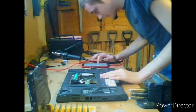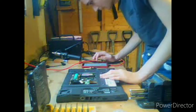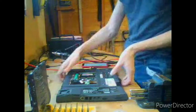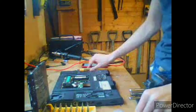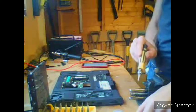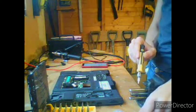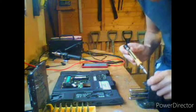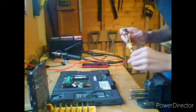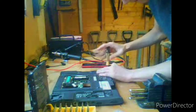It's held on, so I'm going to turn the computer over, and there are 3 M2.5 12mm screws labeled with a circle P, which I see down the bottom corner, both here on the edges. So we need to find the 12. Do we have 12mm screws? Well, I'll just grab the longest. I'll grab 8. 8 should be good enough.